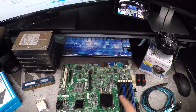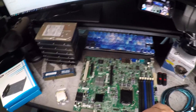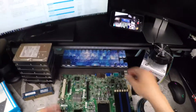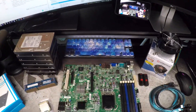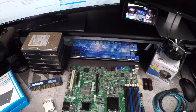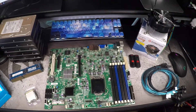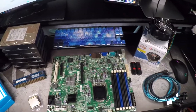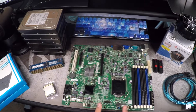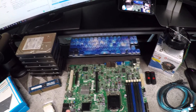So for the motherboard, this motherboard is a little bit different than the one in the build guide. This one is the Supermicro X8-SI6-F. The dash F means that it has built-in IPMI. Here's the dedicated IPMI port, and then you have dual NIC here. If you don't know what IPMI is, it's super handy for turning on your server, turning it off, getting into the BIOS. You can do full KVM — keyboard, video, mouse — through IPMI, through the network interface. It's really just a super handy thing to have.